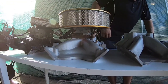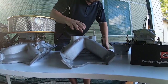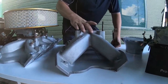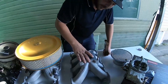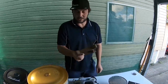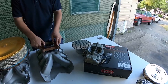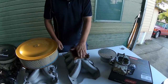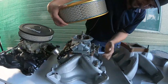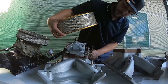But you don't do it — it's ridiculous. You're going to end up with reversion because you're moving the carby flange throttle plates too close to the plenum floor, and you're going to end up with incredible heat soak. The reason I run phenolic spacers is they have the best insulating properties to keep the heat in the intake and not allow it to spread to the carby. On this one in Australian Falcons, you can always get away with a half-inch genuine Holley bakelite phenolic spacer — strong as, really good.